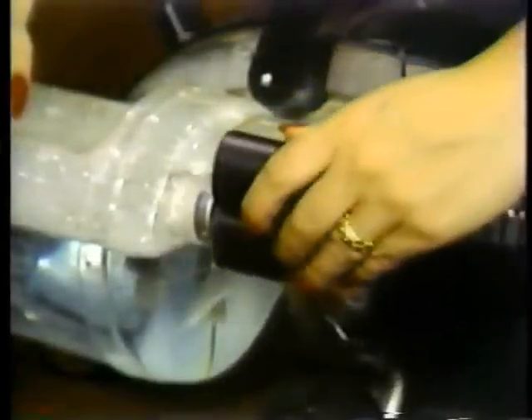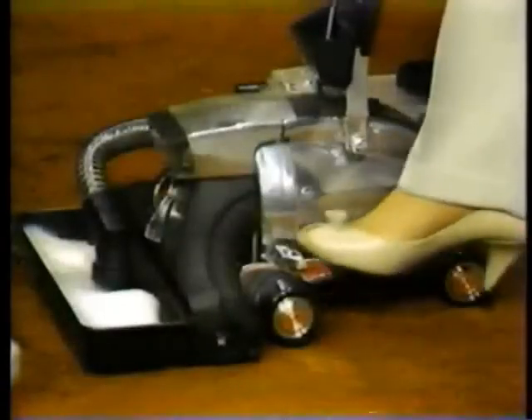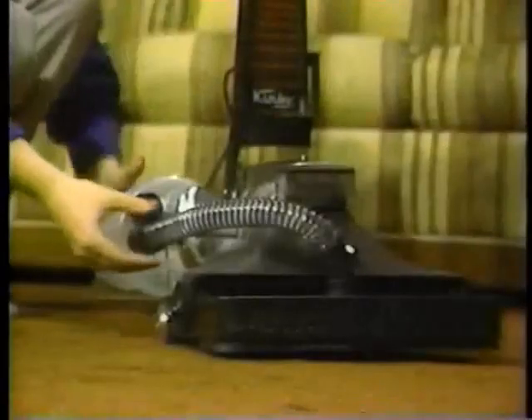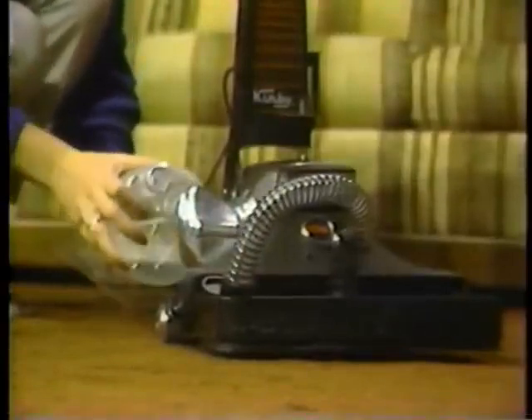Placing the stop suds over the screen outlet will allow immediate and thorough suds pickup, even when the tank is full of solution. Raise the nozzle to position eight when you have finished. Remove the hose from the tank and place it into the tray to prevent dripping.